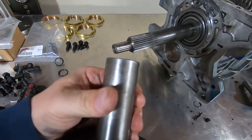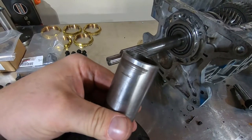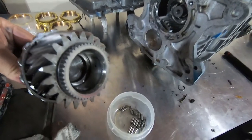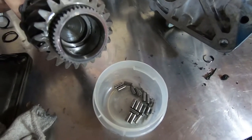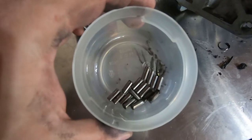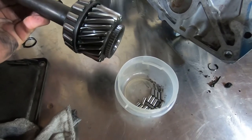Here's the damage — that's why I needed a new bearing retainer. Well, I got the input shaft out — just pulled out on it. When you pull them out, there are going to be some needle bearings that ride in the pocket of this input shaft. Tremec calls for 17 of these; I only counted 16. Some fell in the case — I'm hoping the other one is in the bottom of the case. That means whoever put this together had it running with only 16 needle bearings.